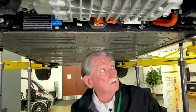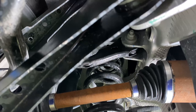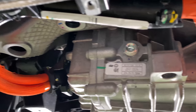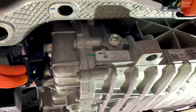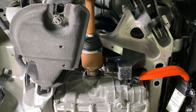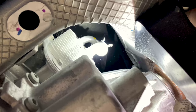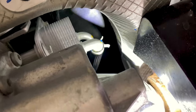Coming back under here and looking up, these are the half shafts that drive the rear wheels. Just like in the front, we've got a coaxial design — this is quite good, we're very excited. The one thing we didn't understand was why the lower area of the electric motor is so big. Frankly, we think it's also a reservoir. We can't take it apart so we can't see everything going on, but the drain plug is obvious and the size is big enough to hold quite a bit of oil. There's a plate cooler up here too, which tells us something is going on in there.